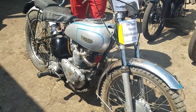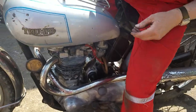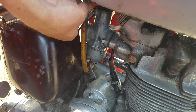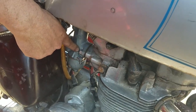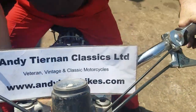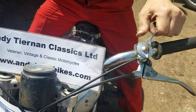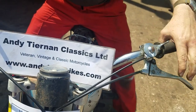So, start it up. What have you got? Just one tap on this side. The lever is up for on. Grab the carb. You've got the ignition advance lever on the handlebars, haven't you? It's a slack advance, so that's fully advanced — retarded, so back off a little bit.